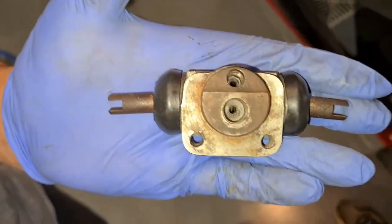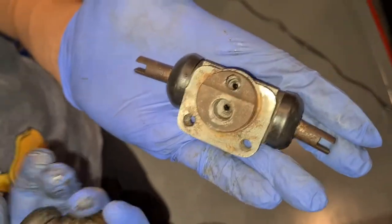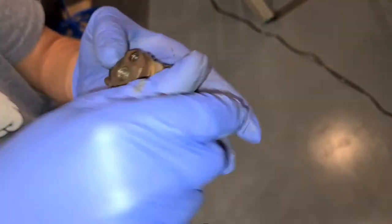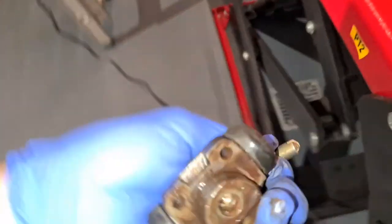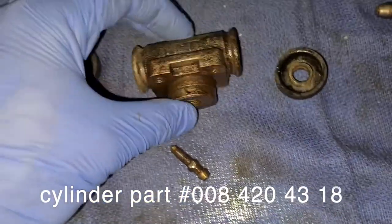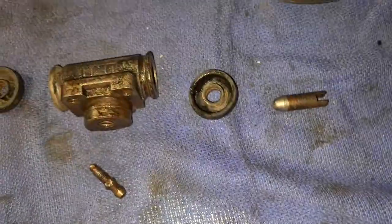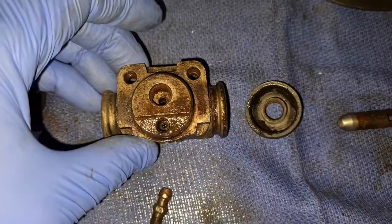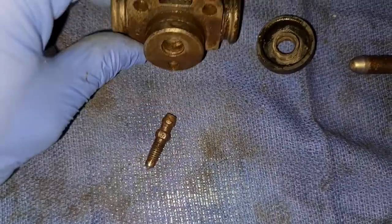Here's the cylinder with the two push rods just pushing against the cylinders underneath the boots — they're not physically attached. Here's another one, off a wreck I had from a few years ago. You can see the disassembled seized pistons in this case. You can get repair kits to rebuild them or you can just buy the whole thing again. It's actually a very basic setup which, as a non-mechanical guy, I didn't realise — it's kind of simplistic.